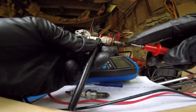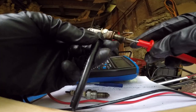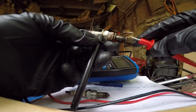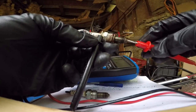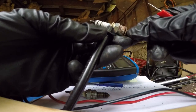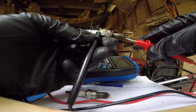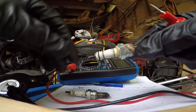So what's happening is when you put the positive on there, you're connecting the outer shielding to the big probe in the middle. Hopefully this is a good angle — you can see it. If you see numbers on the outside, that means it's grounding out on the outside of the plug. And if it's grounding out on the outside of the plug, that means your plug isn't working 100% efficient. Maybe try it in a few spots, because maybe there's a crack on the shielding on the inside that you're not aware of. Play around with it, and then test them while they're hot — test them cold, test them hot. I'm just testing them dirty.